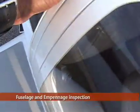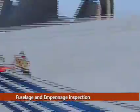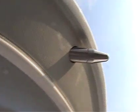Now fuselage left side. Canopy — we've had problems with this before. These are famous for cracking here and here. Check the overall condition, check the window. Door handles — pull the handle, move it, and the pin comes out. There's another pin over here. Check for cracks here and there — make sure there are none.